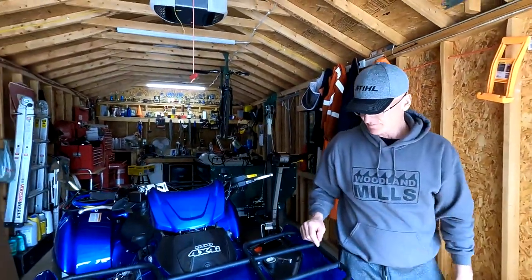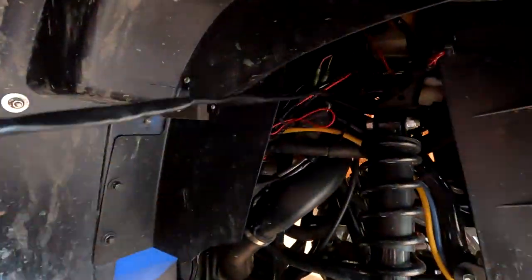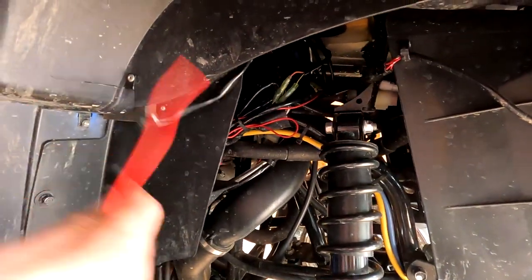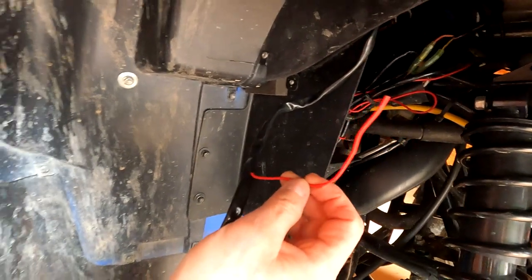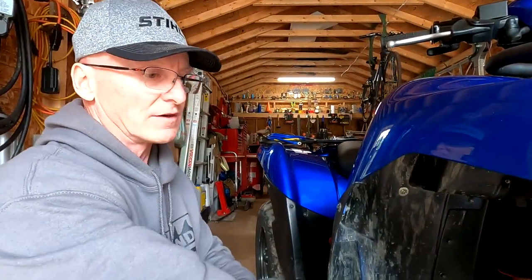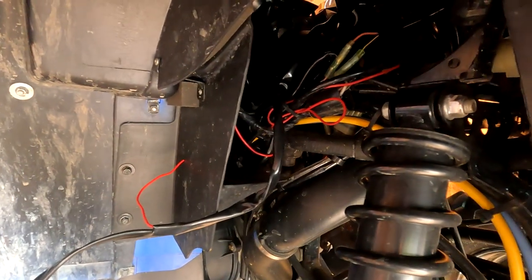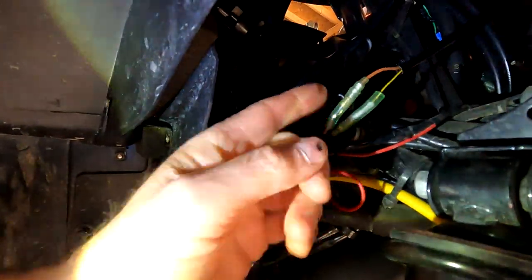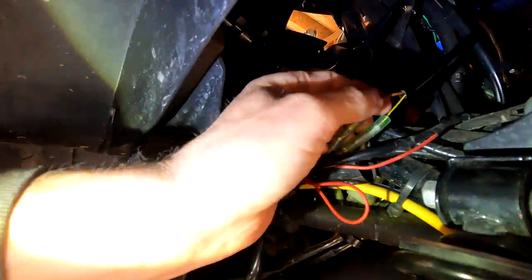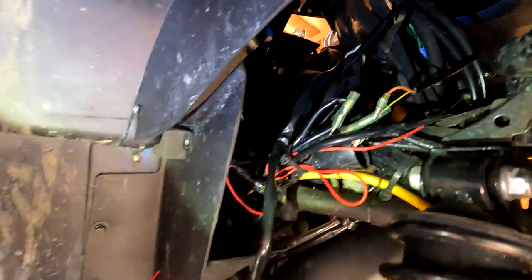You can see down here where the wires come through — I'm going to pull it through. There's a red wire here; this red wire is for key-switch ignition, so when I turn the four-wheeler on it will power the rocker switch. I need to find a source of power. On this side I have a brown wire and a black-and-yellow wire that go up to a 12-volt outlet, and it has a fuse on this side. So I'm going to use that as my power source.